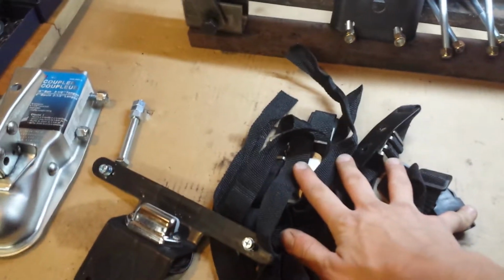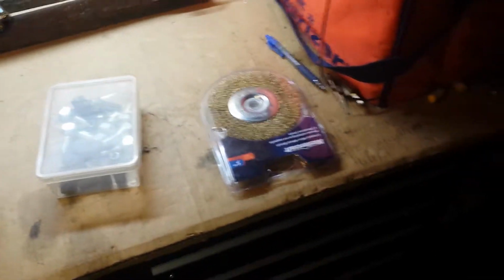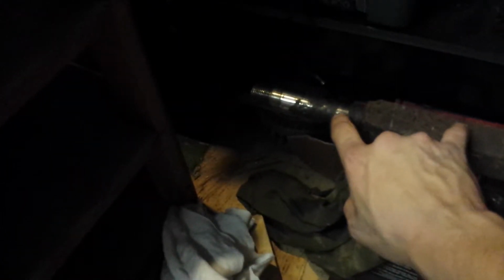Got some tie-down straps, which will be on the inside of the box. They used to hold the box onto a roof, and again, you'll see what I mean by that. So I got the axle down here, which even in itself wasn't that good. The old bearings were seized, and as you can see, the drive home kind of started locking this one up. But the axle is nice and clean. It's in good shape. I just got to clean up the seal point over here, which is covered in gunk. And that should be fine.